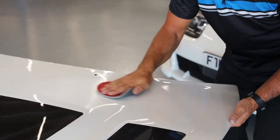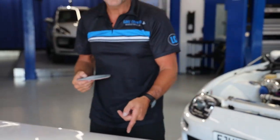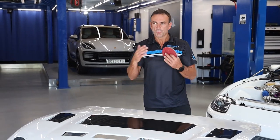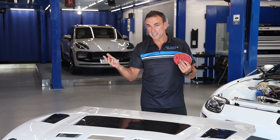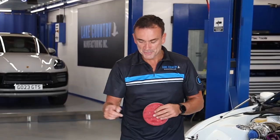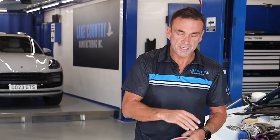This might be quite odd to a lot of people watching this process, that they probably think when the surface is matte, it will never go shiny again. Trust me, it does. It's a weird thing. The first time I saw it, when I was probably 17 in my dad's body shop, over three decades ago, I saw this go matte, and I was like, well, that's wrecked. And then you put clear coat over it and it'll be all shiny again. You'll never see the sanding scores.